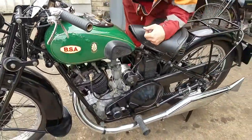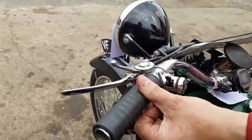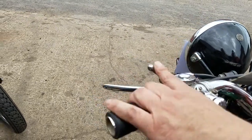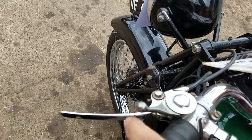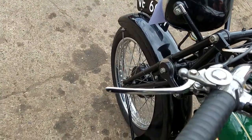Let's start it up — go through the controls. We have a valve under here. Ignition advanced and retarded: tight wire is advanced, so that's fully advanced — fully retarded. Get that halfway. Conventional old Beezer.